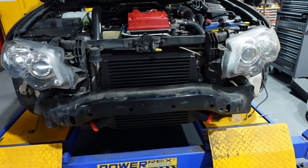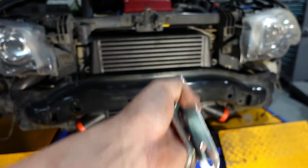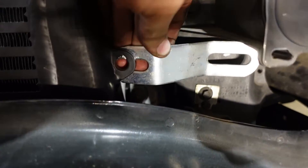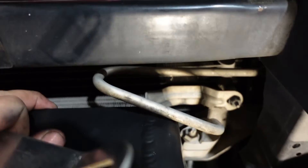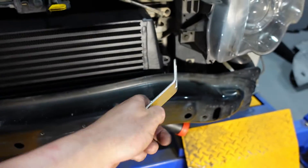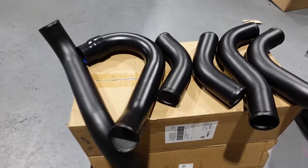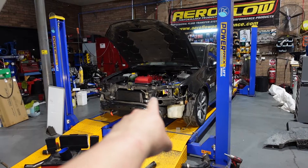I've made up some brackets — I found some material around and made them like that. This will sit behind there, and on that bracket it will actually push the intercooler a little bit more forward to give it a bit more clearance at the back. I'm going to bend it a bit more, drill the hole where I've marked, put a self-tapper in, and put a bolt through there. I've blown all the silicone joiners and all these pipes out and I'm just going to piece them all together and chuck it on the Falcon.